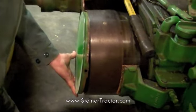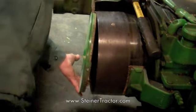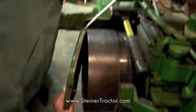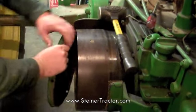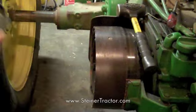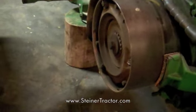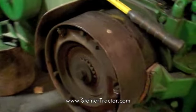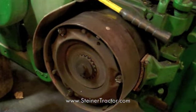First thing is removing the clutch pulley dust cover, and sometimes that can be a real pain depending on if the cover is drawn tight. The best thing to do is use a large flat blade screwdriver and perhaps a dead blow hammer or rubber hammer, taking time to pull that off. Be mindful there's probably a lot of dust and junk inside — if you take an air hose to it you're going to make a heck of a mess.